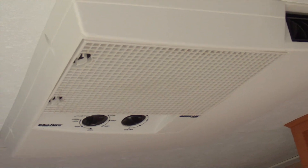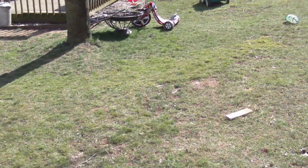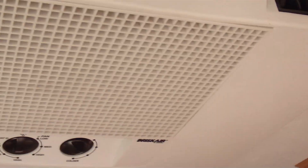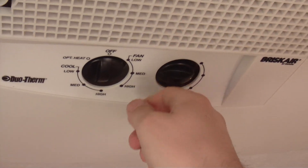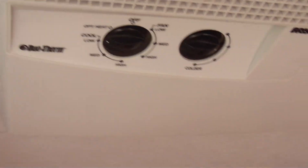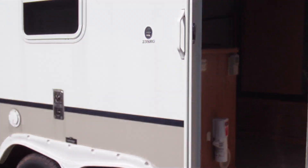I did do the pull on this one — I plugged it in. I just don't have an easy way to do it; I did it with the house power. This AC has a surge start of no more than 1,500 watts — I could never get it to go over that. Then it slowly went down as everything got moving. RMS was right around 1,200 watts running the AC with the fan on high. Let that idle down and cool off. The microwave in this camper actually used 1,500 watts, which is more than it takes to run that air conditioner.